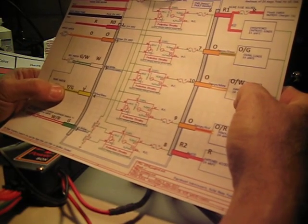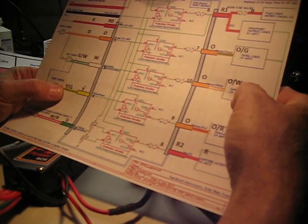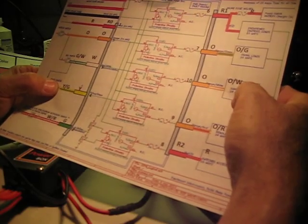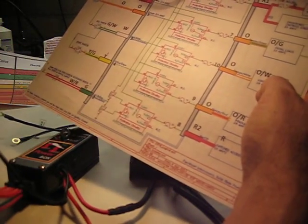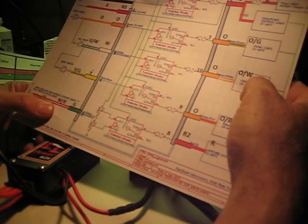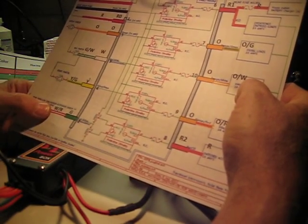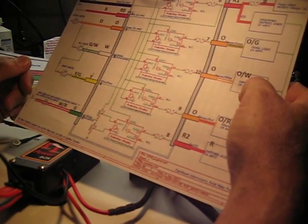You'll also, if you want to dim your headlamp or kill your headlamp while you're cranking, want to use a start switch output, which is the yellow-green, and you'll want to route that through this yellow wire to get it to the solid-state power box. The white-red is another spare wire, along with this green-white. It's the other spare wire from the headlamp loop. You're going to want to bring that into the green.